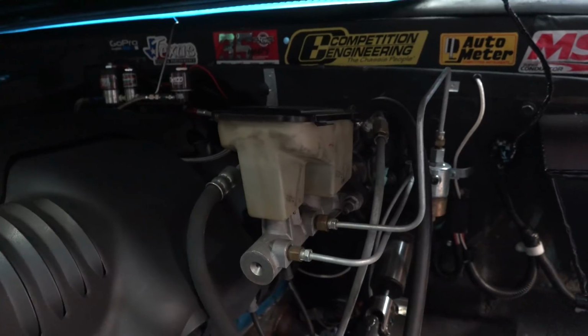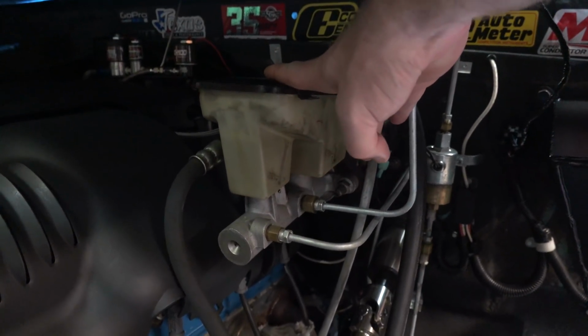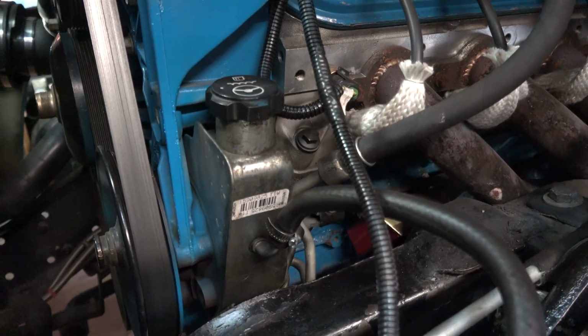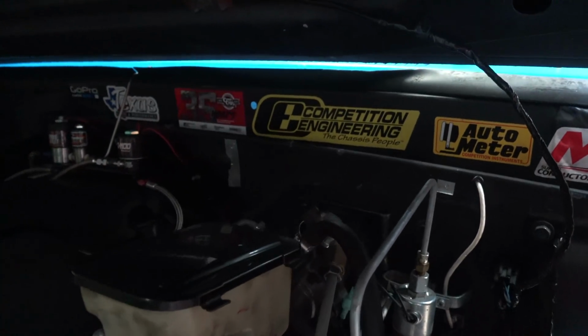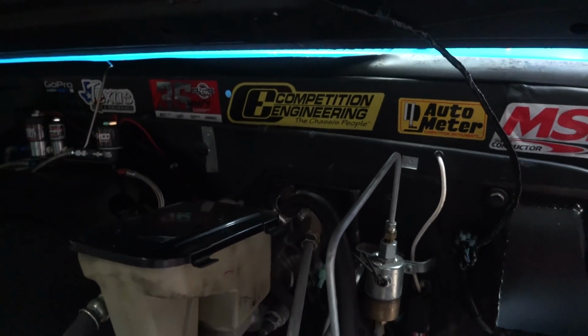So when I did the LS motor swap, I also went ahead and added this here. It's the Hydroboost setup out of like a 97 AstroVan. My front accessories, my power steering pump, already had the 3-hose system, so I was set up for it. All I had to do was swap over to this style master cylinder and booster and use a little adapter bracket sort of thing that I cobbled together to get it all fit onto the firewall.